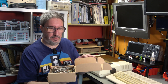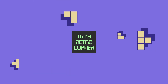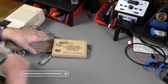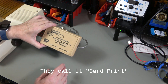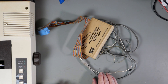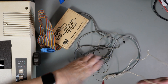The reason is because of this - a Centronics parallel interface for the Commodore 64. Looking out of the box, it's a Cardco Centronics parallel printer interface with graphics for the VIC-20 and C64 computers. It's basically a box, an IEC cable, and a Centronics cable. The Centronics port plugs into the printer and this plugs into the C64.